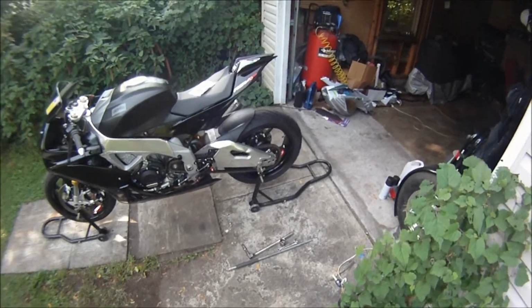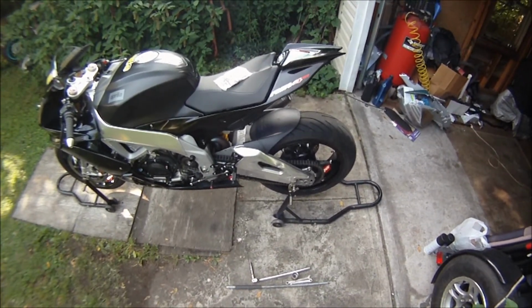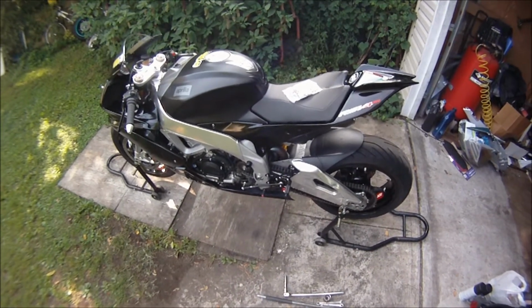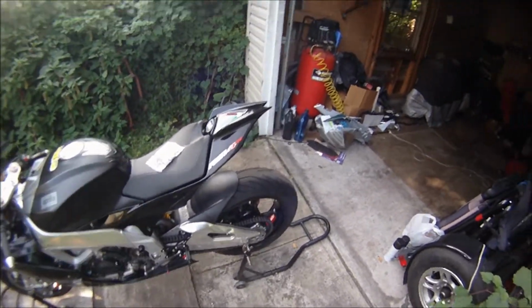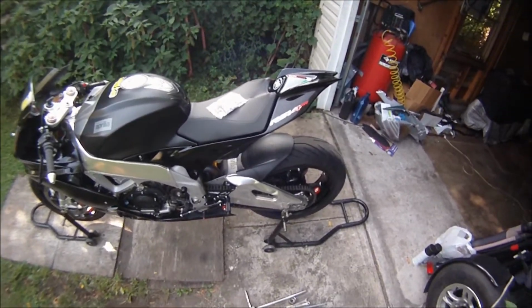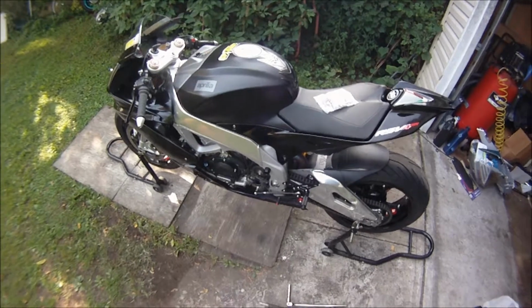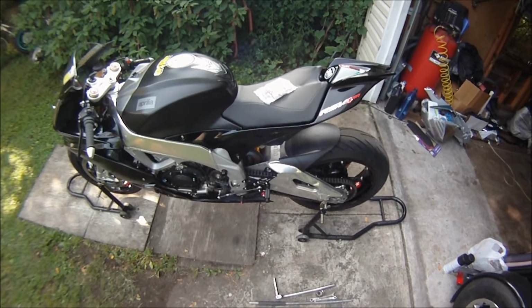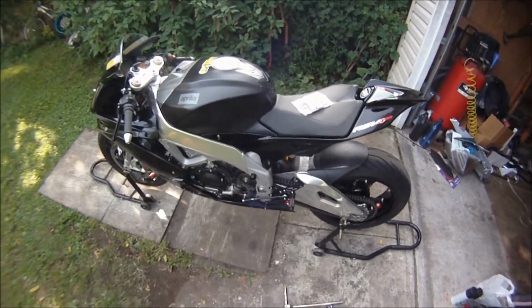On this bike I'm going to leave the stock rear sprocket as is, because I heard that with the increased horsepower on this engine, if I leave it at 15/44 like on my 2013 RSV4, it wheelies too much, even though it has the anti-wheelie. So we're going to leave it like that and see what happens. If I feel like I can use the 44, I will put it on. But definitely the 15 tooth up front, because it's too tall.